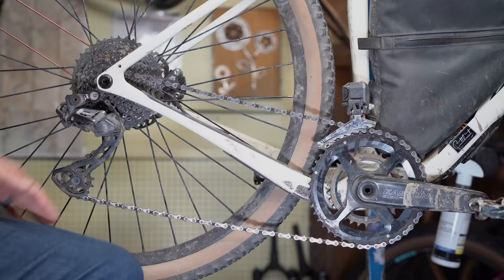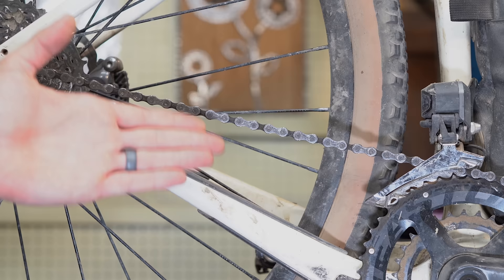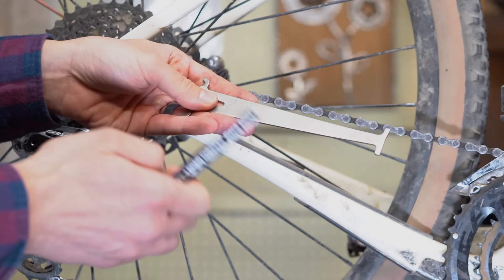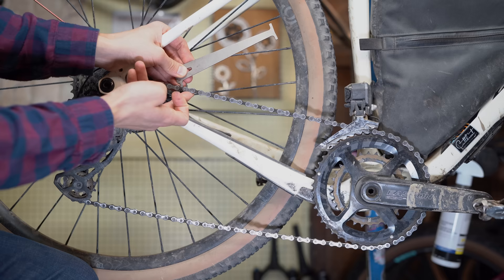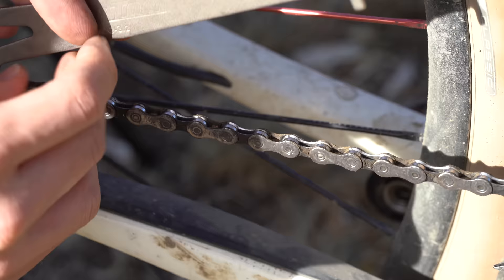The first thing we're going to do is check the chain — it's the lifeblood of your drivetrain. You can get away with one gear, you don't need all these cogs or two chain rings up front, but without a chain you're obviously not going to have a functioning drivetrain. There are a variety of different tools to check chain wear. Today I'm going to use two: the Park Tool CC-3.2 and the Park Tool CC-2. You always want to place chain checkers in an inner link so it doesn't interfere with the links themselves — it just butts up against the rollers. Putting it in, it went into 0.5%. Let's check 0.75 — it goes in with tons of play.